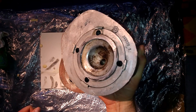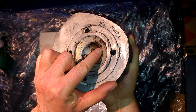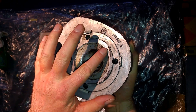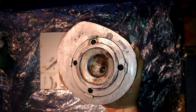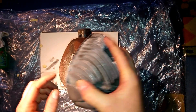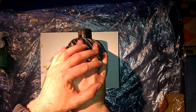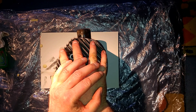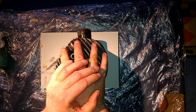You can see, for example here on my cylinder — it's hard to see, but there is a hump. It's a little bit brighter and you can see that there is some grinding. Make sure that there are no deep scratches occurring, and continue until you have the feeling that the surface mates nearly perfectly.